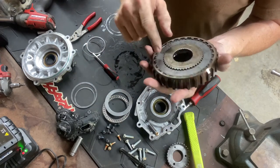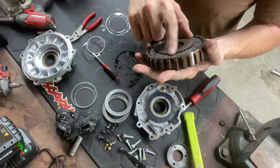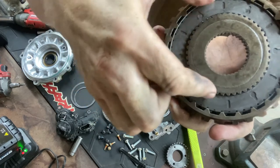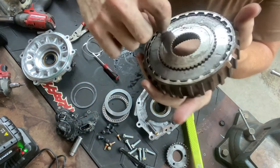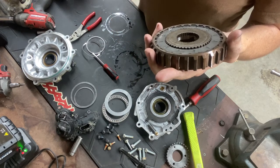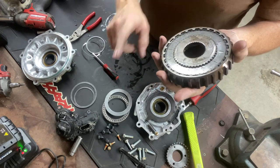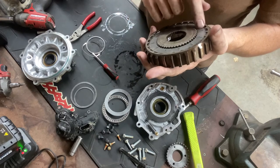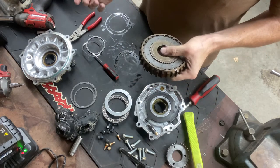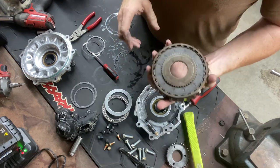Put the clutch pack back together. Just a note - it's steel on steel, or like a bike it's steels and fibers. There are 17 discs - 17 outers and I think 16 or 17 inners. In short, it's all back together. This little ring retainer - make sure when you put it back in, it's tucked under the teeth all the way around, otherwise it'll all pop out. If you were ever gassing on it hard in four-wheel drive and the passenger tire was basically not spinning - slipping - it's either probably a broken spider gear or your clutch pack could be worn. If you pulled the discs and they were blue, yeah, they're toast. You shouldn't really ever break this part. Spider gears break from time to time - they only broke because I'm running a bigger, stickier tire at King of the Hammers and I landed with the gas on. I mean, it's purely my fault. But that's how your clutch pack works.